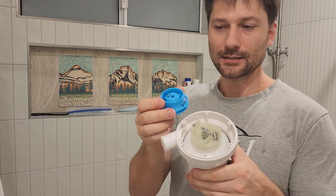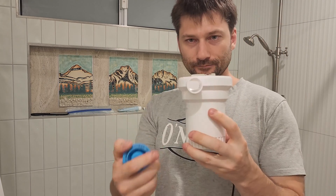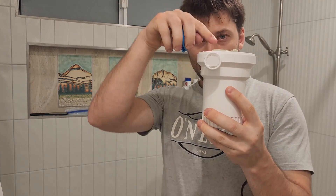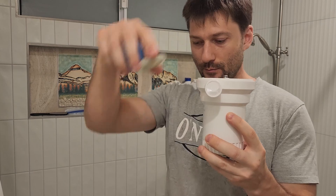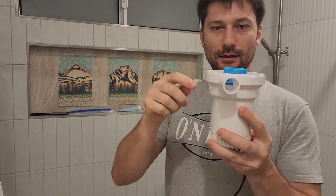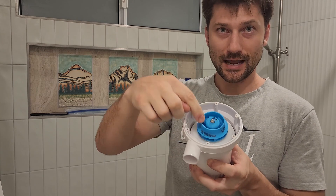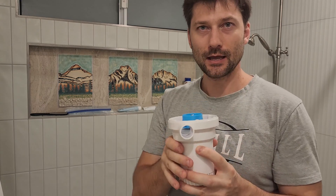This is three millimeters down as well, so it's going to press up against the same piece of plastic, but I've dropped the entire impeller down. If you look through this hole you can't actually see the impeller on the stock — it sits a little high. Whereas when I remove the stock impeller and put on this 3D printed one, the top is at the same position but the impeller itself you can actually see through that hole, so it's more aligned where it's supposed to be.